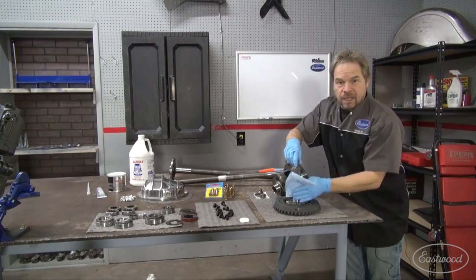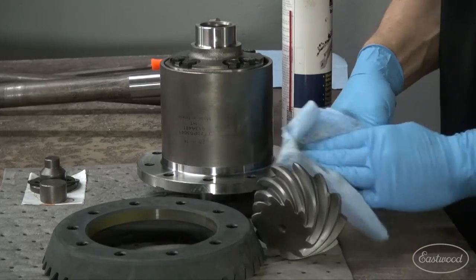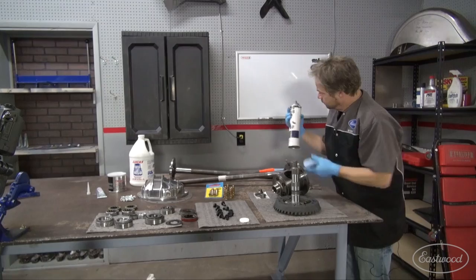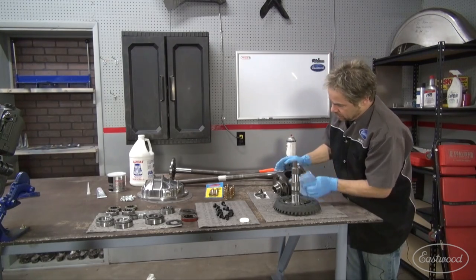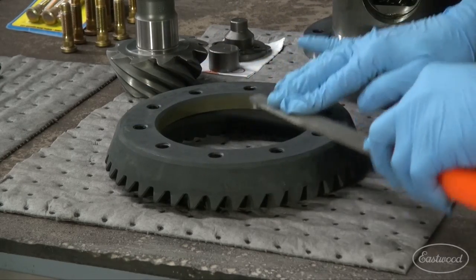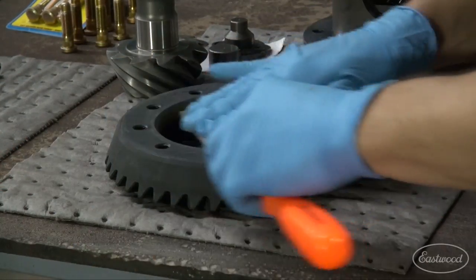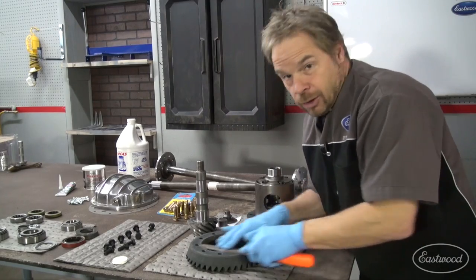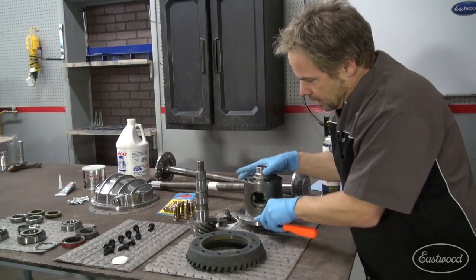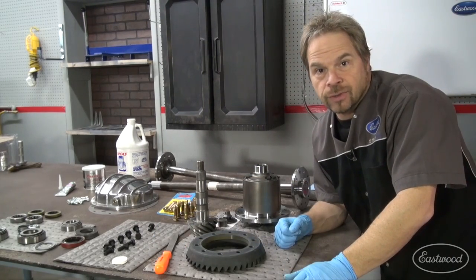It's pretty important that you wipe everything down before assembly. Parts are shipped in a coating that prevents corrosion on a loading dock, but it might interfere with proper performance — a little bit of chassis cleaner works great. You also want to run a flat file over the ring gear just to make sure everything is properly machined, with no stick-up or burrs that could cause run-out on the ring gear. That would be really bad. Also double-check your carrier — everything looks good, cleaned off, and ready to mate.